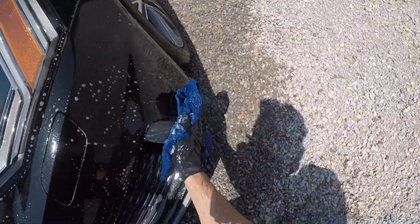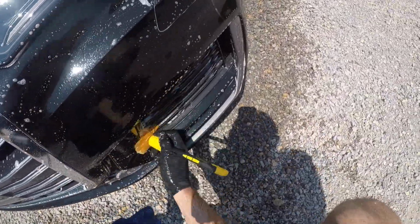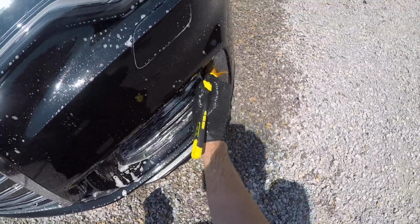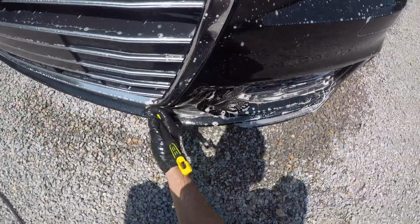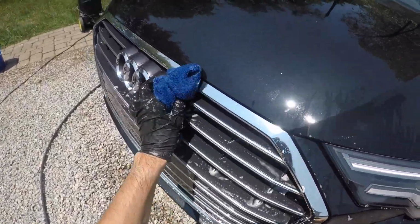And you can see I'm using a really soft microfiber towel with this, because this front grille is made up mostly of paint. There's the classic kind of front plastic area that I'm going to use a detail brush in, but a lot of this is just exposed paint. And so I like to take a soft microfiber towel here, but more importantly, again, in direct sun, 20-to-1 for my bug dilution ratio here. The reason is the exact same.